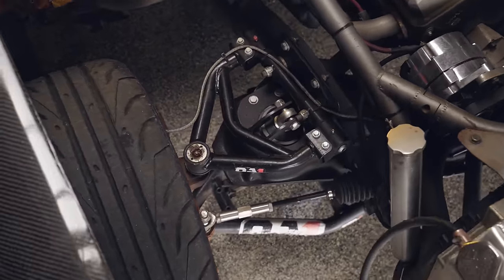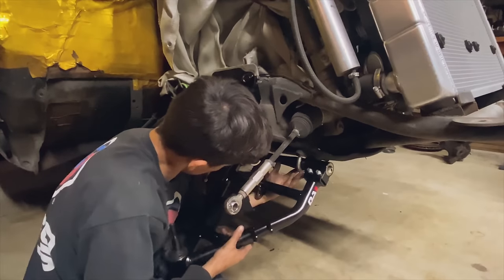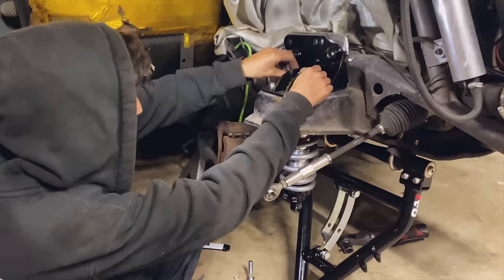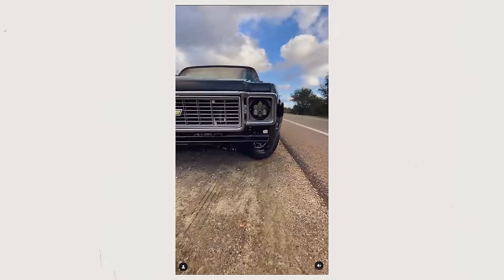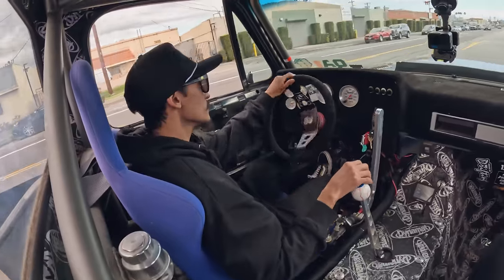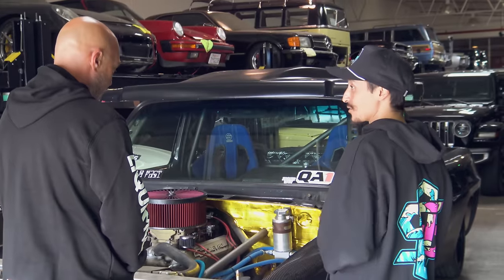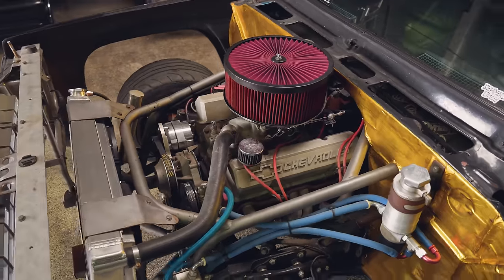QA1 is a big company that's helped out a lot with this truck and a lot of my client builds as well. Their components are mostly bolt-on which makes life really easy - even for a fabricator like me I only had to modify my steering knuckles to get good angle. These arms are way lighter than factory ones, narrow profile, so you get the angle I have now. They make a full bolt-on kit: coilover, rack and pinion, everything for these trucks. I beat the hell out of my truck and these things handle and take the abuse - and they're made in America.